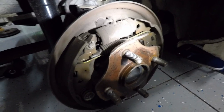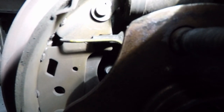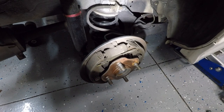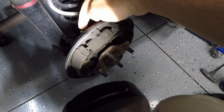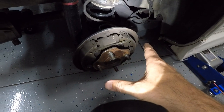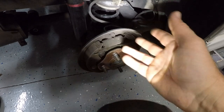There's also a little horseshoe-type clip — you've got to bend an ear off of it to get the shoe off, then reinstall it. It's an annoying little metal clip that pretty much every car with drum brakes has. The last thing to touch on is this little piston. If you look behind the drum you'll see the brake line leading right to it. Inspect that piston and make sure it's not leaking. If it is you'll need to replace it. This one's covered in dirt but there's no liquid anywhere, so I know the piston is good — just needs a clean with some brake cleaner.